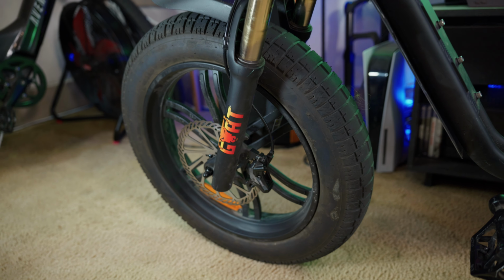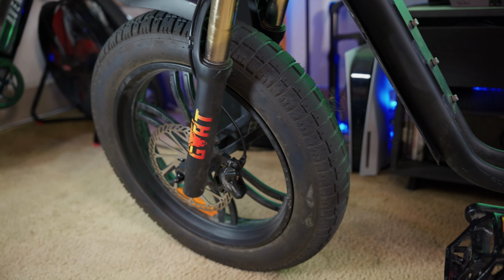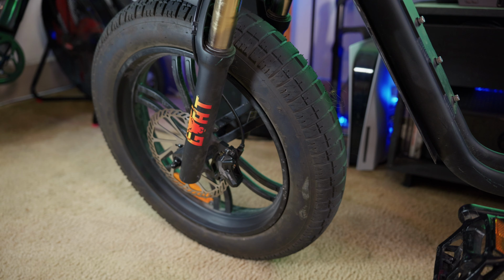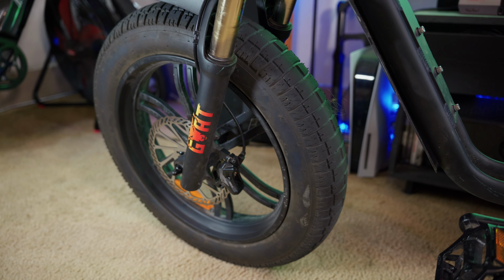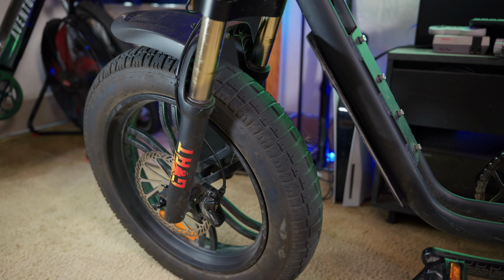They have a lot of grab to them. However, I have had some issues. After some hard braking, I would hear brake rotor noise, and I assumed my caliper came out of adjustment. So I'd readjust the caliper, and then I'd notice the sound went away. But almost every time after some hard braking, I'd start to notice that I would have some rotor noise.